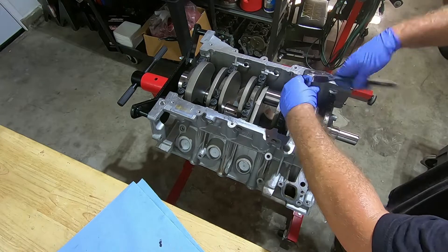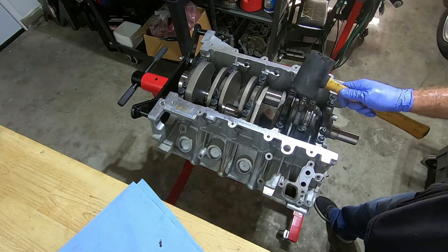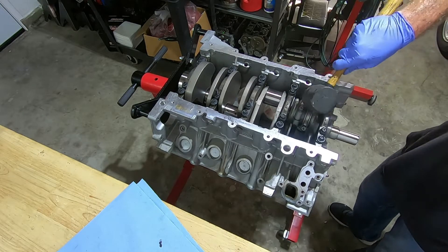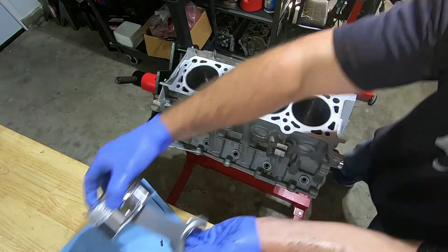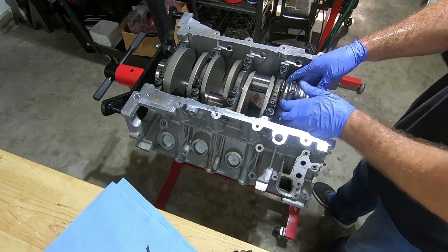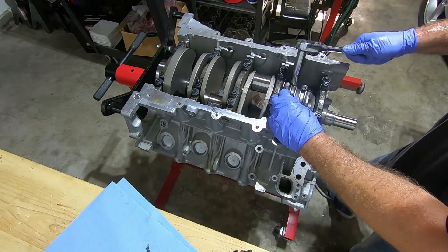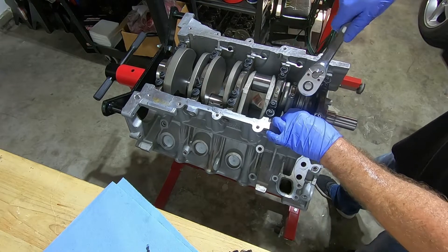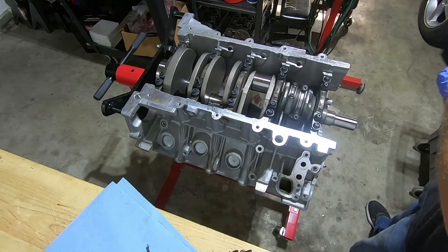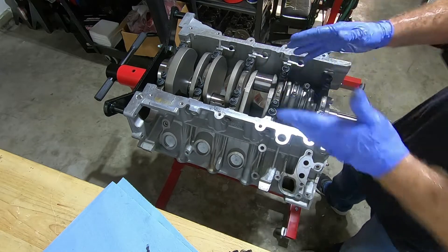First I'll get the bolts loose. My bolts are backed out about a quarter of an inch. Just take a little mallet and tap down on them — could be a rubber mallet or a wooden mallet — basically just separating the rods again. So this is way better, I can already tell. I got all four of them snugged down just a little bit and you can see the rods have end play — they're moving, you can wiggle them back and forth. Once I rotated the engine around, it was already starting to go back and forth. So that's what I'm going to have to do.